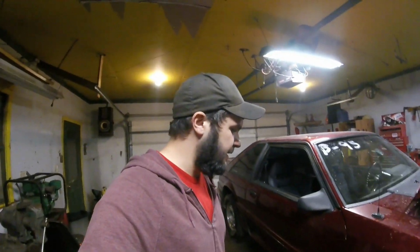How's it going, YouTube? Today we're going to be working on the Mustang again, and I finally got some coil springs for it so we can ditch these lowering springs and hopefully have the car work a little better and not be bottoming out as much. I talked to a few guys and I got stock rear springs with one coil cut off, and then I got stock, I think they're V8 springs for the front, but still better than what I got probably.